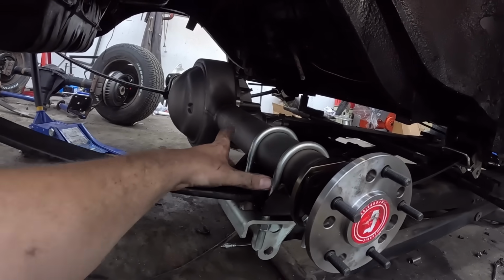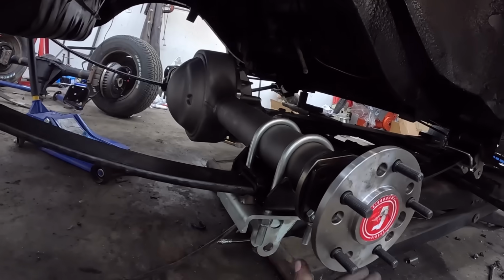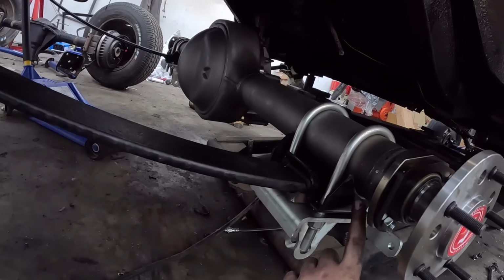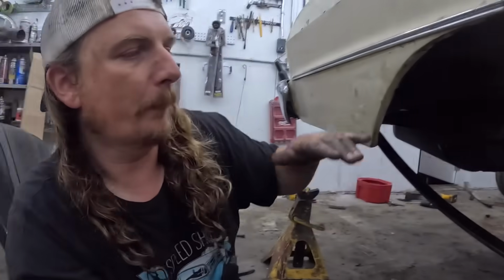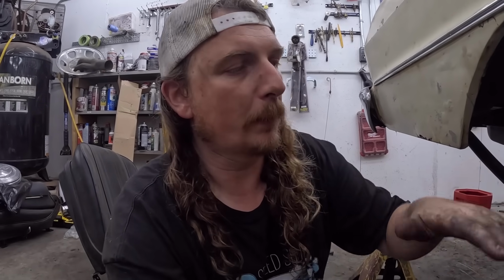But obviously we don't want to. It'd be a lot easier to do without the brakes in, is what I'm saying, because that will be going like a straight up angle versus this. I can get in there very easily, you know, big deal. So we'll end up setting this thing on jack stands, setting our angle finder, get where we want, we'll tack it all the way around, then I can lift the car up, and then I can burn that in both sides with it in the car, and it'll be just fine.